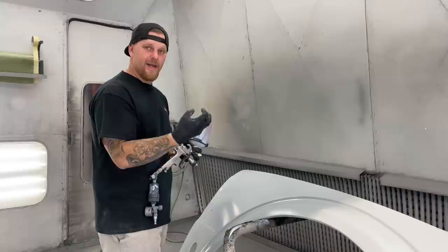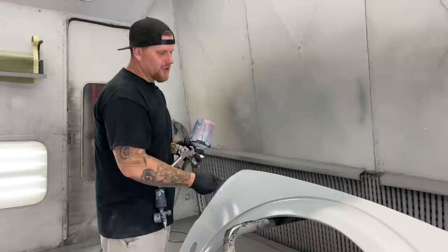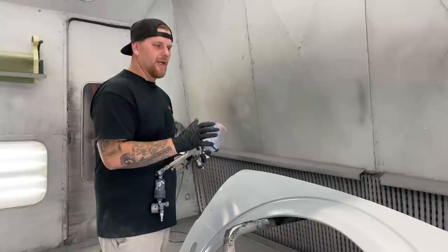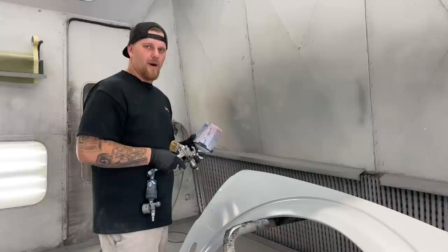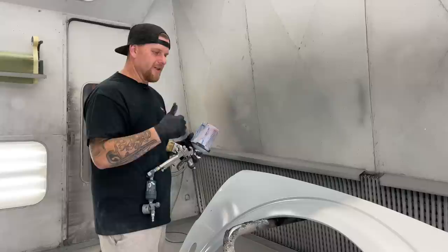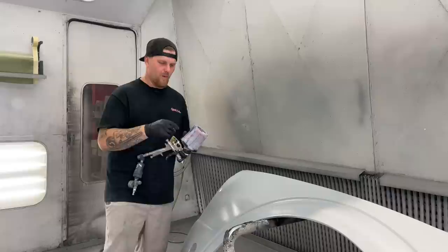Make sure you have everything sanded in that area so nothing fails to adhere. If you're putting a graphic through it and you go to pull your tape and didn't have the area sanded properly, it's going to rip all the paint off. That's also why a lot of painters won't touch anybody else's bodywork that's already been done — if you can't guarantee the adhesion is there, you're just looking for problems. We've had cars with delamination problems all over the board from that. Even a Brillo pad will help adhesion. The more you go through this process, the more you'll understand that the details in every one of these things matters.